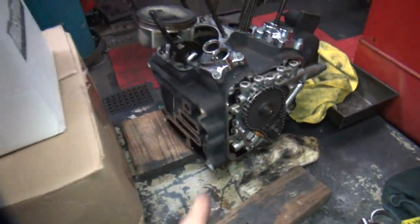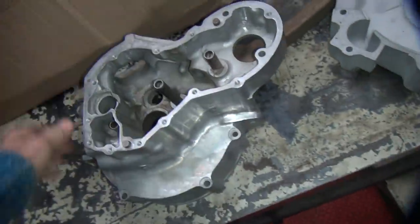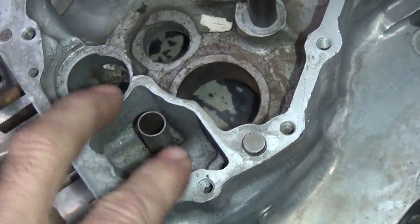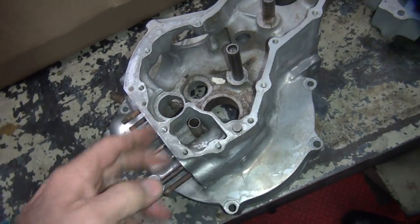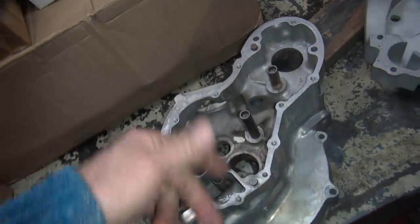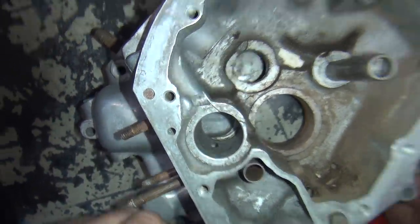Here's a motor - that does not have a breather in it, that's not a real Harley motor, that's a Twin Cam. This is a left case, this is a right case - this has been polished, it's a show bike. See this cavity right here? Does it look similar to the other part? Yes - that was full of oil. This fills up full of oil in here. The two tubes go like that, so the air goes in, blows around, comes back up, goes back down - that's called oil separation. On these older motors they actually had a screen that went in here. On the cone motors they eliminate that screen because the two tubes make the air have to go in and make a U-turn. When you make that U-turn, the oil will tend to drop out. That little tiny hole right there goes down to the bottom deep inside there.